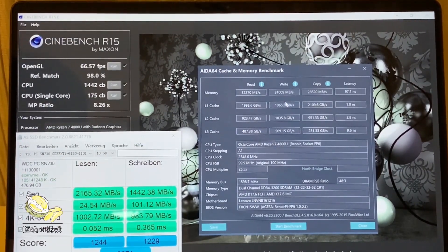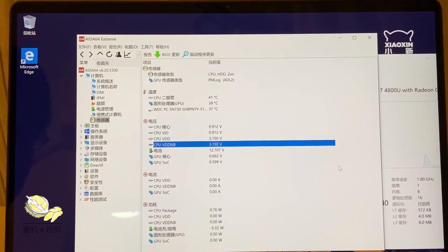After some simple benchmarks, everything is pretty standard on paper. The RAM speed is okay — slower than Intel but definitely good enough in the AMD series, which is a progress for AMD. The SSD benchmark is very good with fast 4K and sequential read/write speeds. The Cinebench R15 score is pretty amazing considering its small size — even higher than the 15-inch version for multi-core CPU. OpenGL is also higher than the 15-inch version, while single-core is slightly lower, but everything is within about 10% difference.